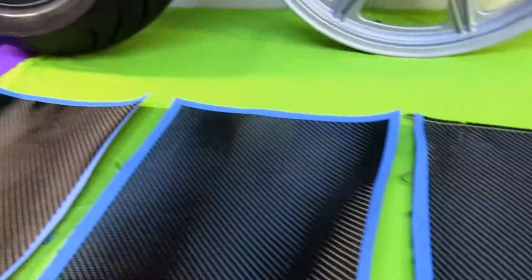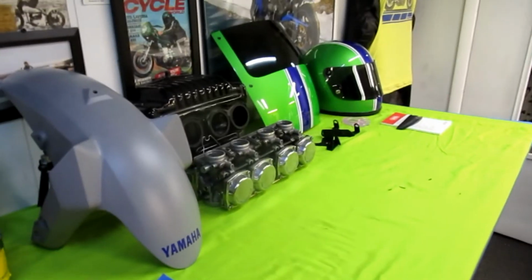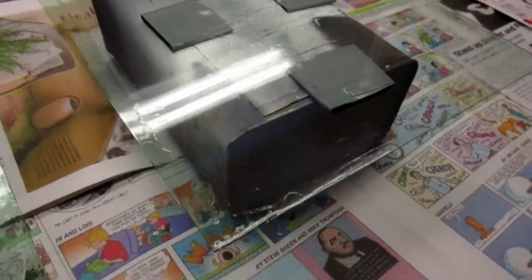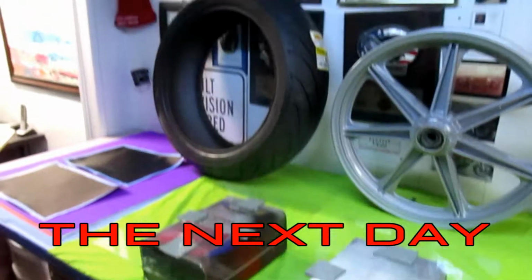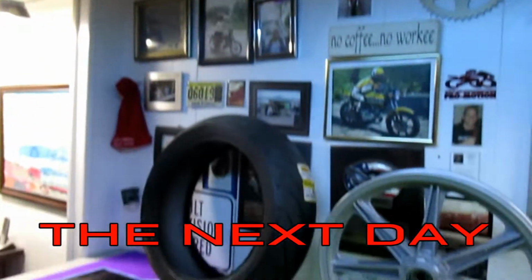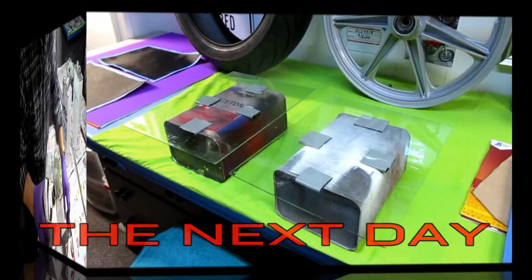And that PVA really does take, I guess you could dry it with a hairdryer. I've done that, but it's always better to just let it dry. If you're going to do a lot of this, it's good to set up a dedicated spray gun just for PVA. So the PVA has dried under a heating vent, and of course if you spray it, it's a lot better than if you brush it, but either way you just have to get some PVA on there.